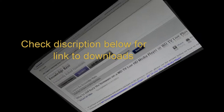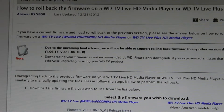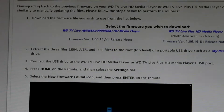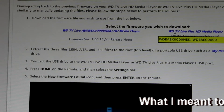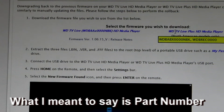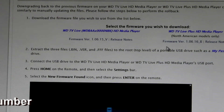To get started, just check in the description for a link to this website. It will give you the firmware that you need in order to roll back. Just cursor over the purple highlighted stuff — it will give you serial numbers of Western Digital boxes which you can find in the About section. Check to find out which one you need to download by corresponding the two. I have a North American one so I'm going to use the North American firmware.